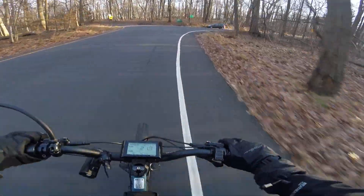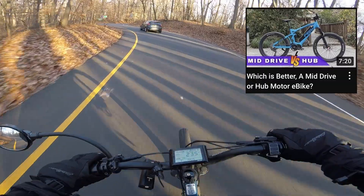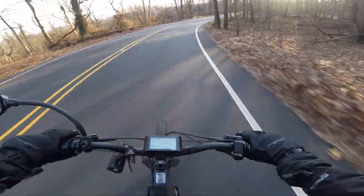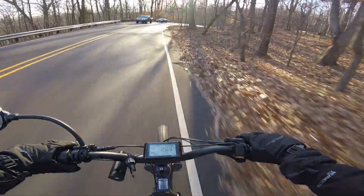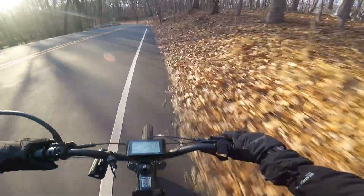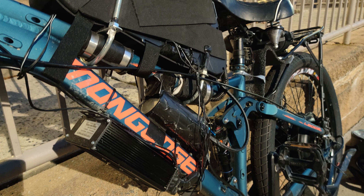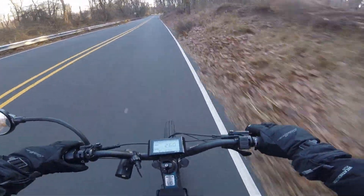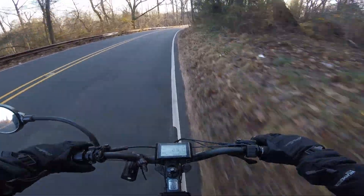When it comes to building your own custom bike, the very first decision is whether to go hub or mid drive. I made a whole dedicated video on this topic. The TL;DR is that hub motors are extremely plentiful so you can find the right match for power and price, but mid drive motors have their own advantages. One I didn't realize until recently: mid drive motors don't have an external controller. My controller is rather big and mounted on my bike, but with a mid drive system that part would be completely eliminated, which really helps with cable management.